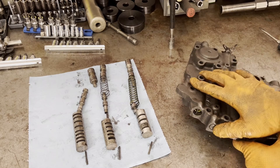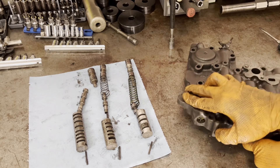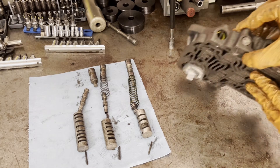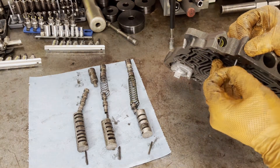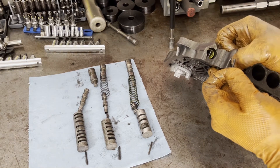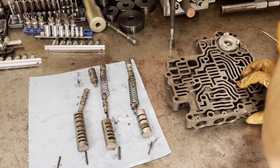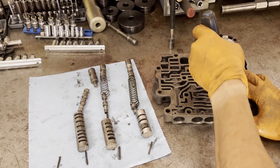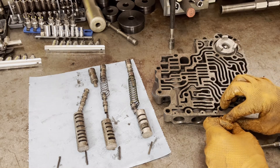Here's our manual low control valve. Now this is under spring tension, so you want to have a hand or finger over the bore, and then just push in on it and it should come out. If not, just pry out from over here like all the other ones. What I did is pried out while pushing in and that popped it out.